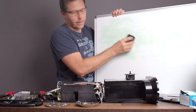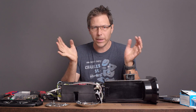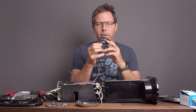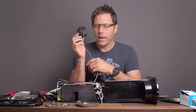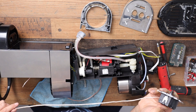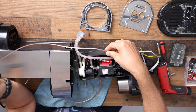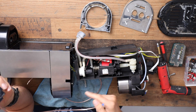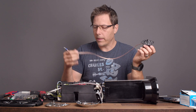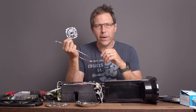I've already gotten started here — I've taken this thing completely apart, which you have to do in order to get to the pump. This dimmer is an inline thing, so you need to put it in line with the pump itself. You can't really put it anywhere else in the circuit — it's got to be in line to the pump. I've already got one lead here and we're going to make this so we can attach it to the pump with clips, with the other end attaching to the clip that was on the pump, so it's in series with the line.